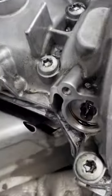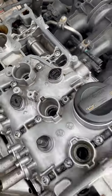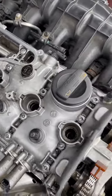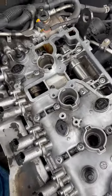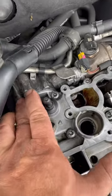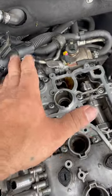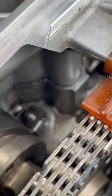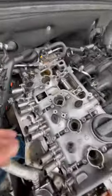Alright, people — as you can see, the gasket is seeping out. These cars don't come with a gasket, so you have to make it yourself. I've used regular black silicone; AutoZone carries that. That was fairly easy — just clean it up and make a nice seam, maybe about a quarter-inch thick. Once you start putting everything back, remember this area right here. That's where you'll probably struggle the most, but you have to put in the valve cover with an angle, this side in first. The valve cover will have two alignment pins — one there and the other one in the middle.